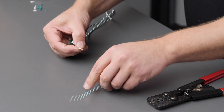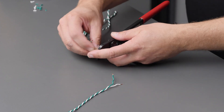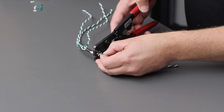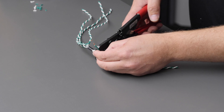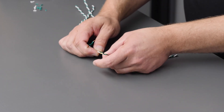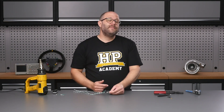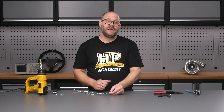Just holding those and squeezing them together, we can get those through into our tool. Double checking we've got all our copper conductors coming out the other side, then from this side I'm going to install the inside of the crimp. Just double checking everything's in place, then squeeze the handles and crimp that splice down. Looking at that we've got a nice reliable crimp connection. I can really pull on that quite hard and it's not coming apart — that's going to be a nice reliable splice join. We know that was going to be the case because we verified the open barrel terminal sizing was correct for the number and size of wires.